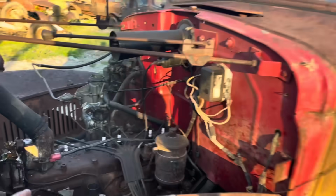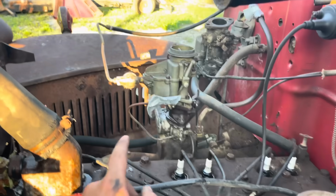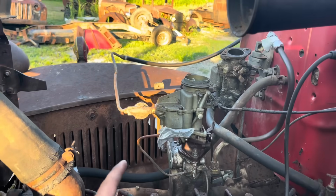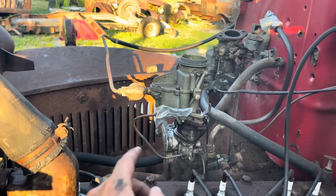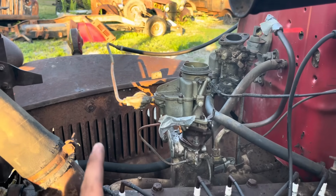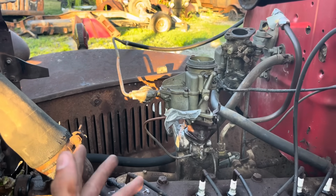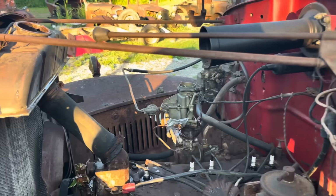The smoke coming out of there is blow-by, and the steam coming off that side is boiling fuel vapor because it's leaking out of there. I tried tightening it. That worked for a little bit, and then it started leaking at the back part there, and then this thing started leaking the catch bowl because it's not supposed to be leaned sideways, but I couldn't get it tight enough without leaning it sideways. But all in all, she runs like a brand new machine.